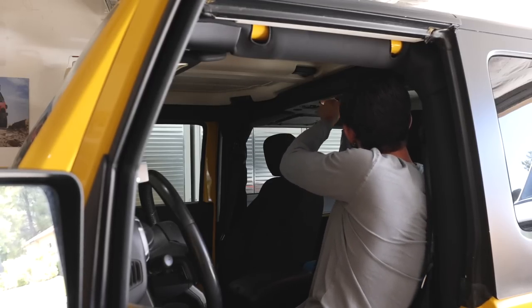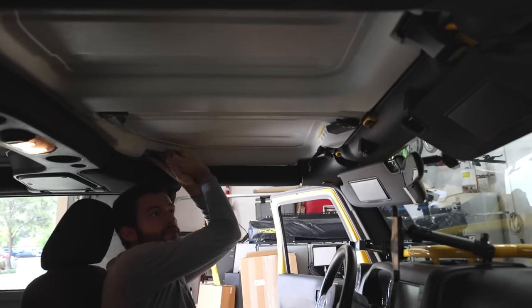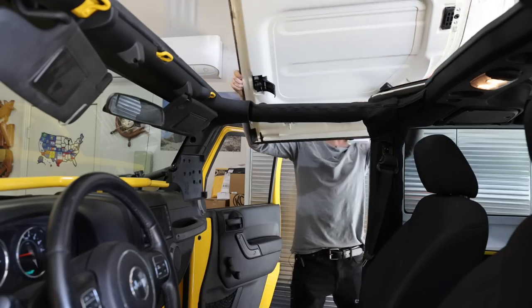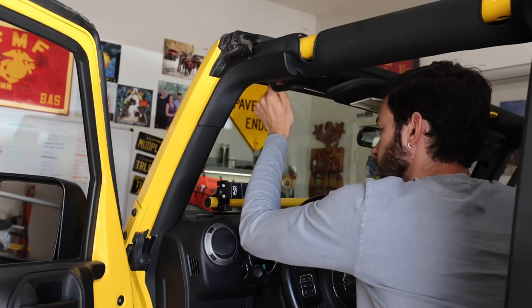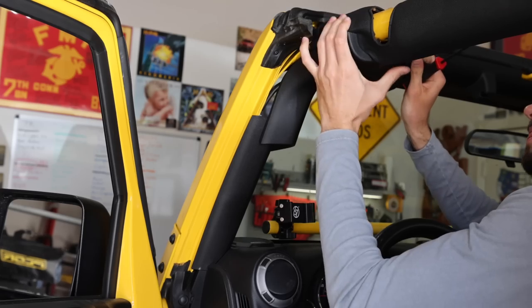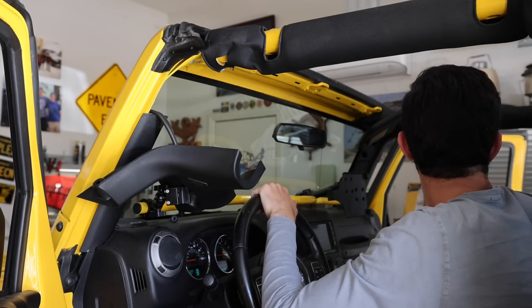This is probably the simplest part of the whole install, but the last time I had to take off the two roof panels, I don't think I put them on correctly afterwards — I took it through a car wash once and some of the soapy water started leaking through all over my camping equipment. So just a word of warning: when you're putting this back on, please make sure it's sealed. Once you remove the roof panels, you'll want to remove the driver's side sunshade as it's just going to get in the way of everything. Then you start removing the plastic panel through which you're going to be routing the wire. Getting the wire through is a little more difficult — I'm struggling because I didn't realize it was a plastic screw you just pull out and later pop back in.